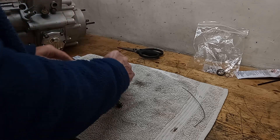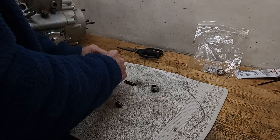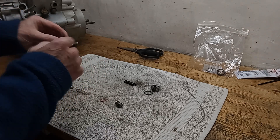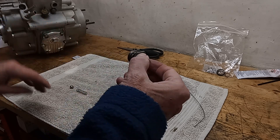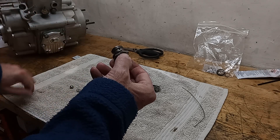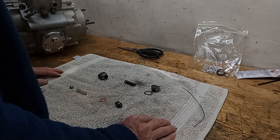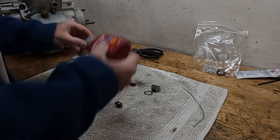What I'm going to do is screw the body on and then screw the cap on. I might just put a little bit of sealant on - the thread is in two parts. I'll put a little bit of sealant on the upper threads. I don't want to put it on the lower thread because as it's screwed in, that will block up the oilways, which we obviously don't want. I've heard of these coming loose and leaking oil all over the back wheel, which isn't great. So I've got a little bit of medium thread locker - I'll put that on.